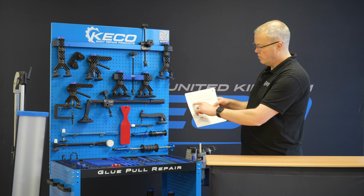So what we can do is grab one of our dead center crease tabs. We have the same effective pulling surface as 7 mil. We have a thin neck, a touch thicker on this dead center tab here, but that will enable us to slide down the middle here. Now because we're point loading this, these tabs all have a certain amount of flex to them. So once they're warm, and as I start pulling that, you can see the middle's flexing.